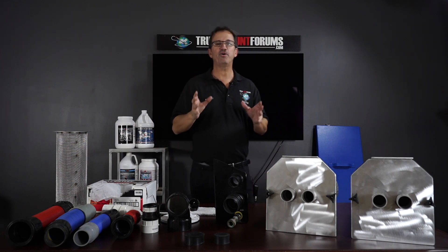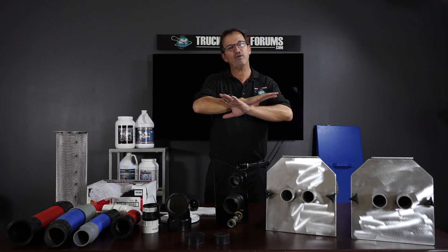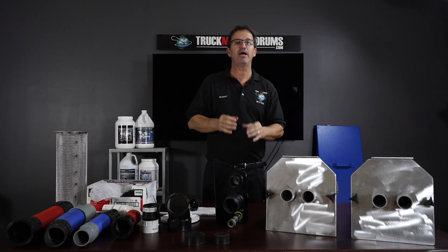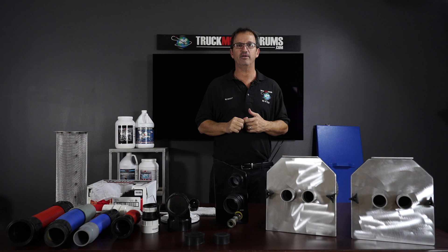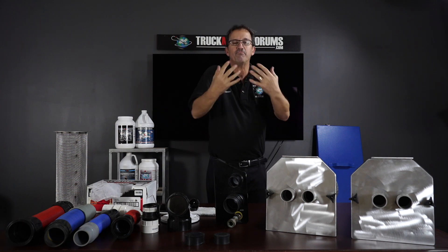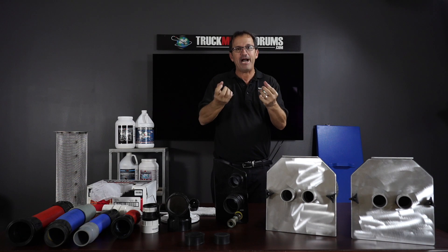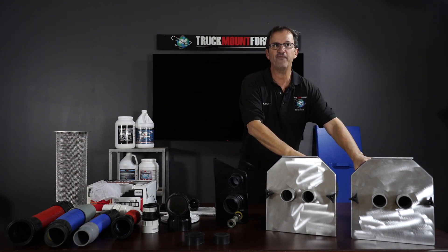The new TMF Boss Filter has been out for a little while and we've had many people writing raving reviews about the units. However, we're getting some feedback where some people do not understand how to either set it up or figure out the best configuration for their truck. It's really important to get it just right, because you want to maximize your vacuum efficiency, your lift, your CFMs, all your airflow — the maximum amount so you can get the carpet as dry as fast as possible and get the full benefit out of the unit.